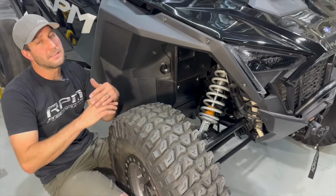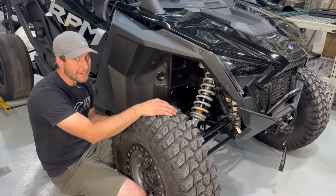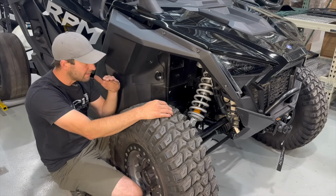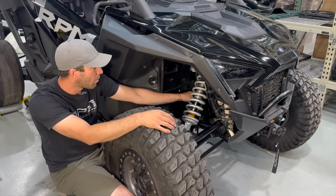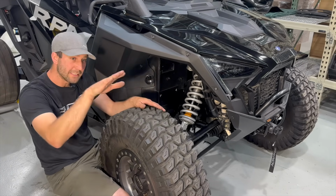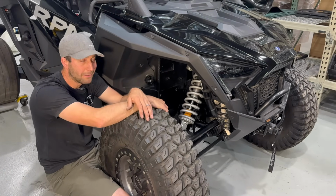and this rigid part just kind of makes it a pain. So I'm warning you now, 2 guys makes this so much easier. If you insist, do it yourself, but you're probably gonna see a couple cuss words. 2 guys, you're gonna see how fast we install this. It's super easy. The reason is that we like to spray some soap and water on these hoses. 1 guy on the other side just pushes the hoses down, helps me pull the deflector through. I push it a little bit, it goes super easy.